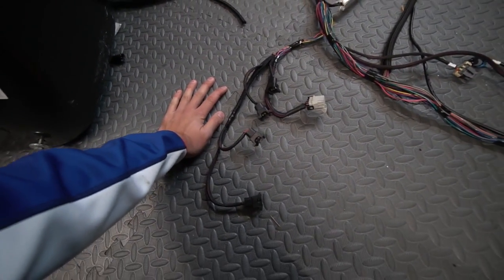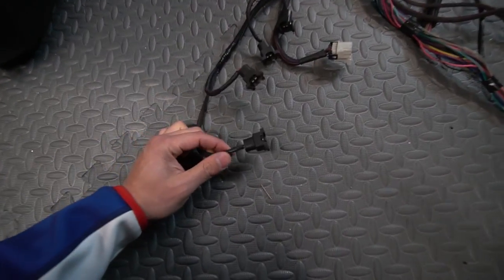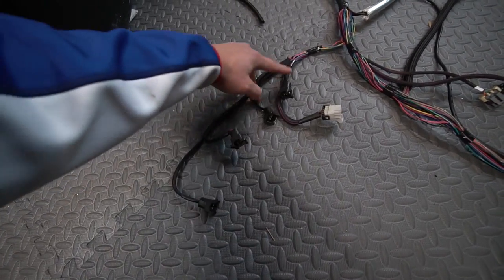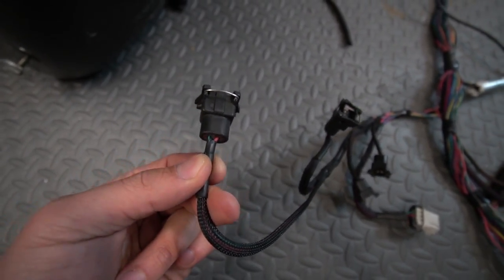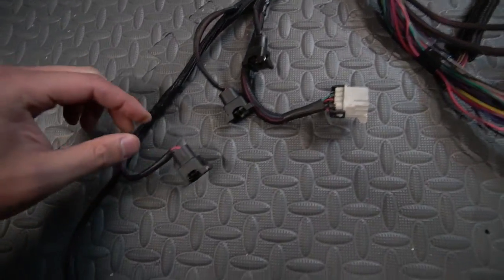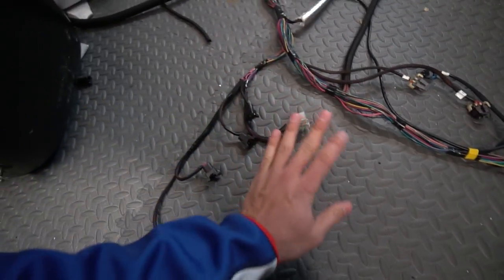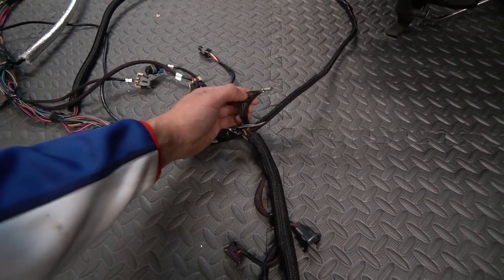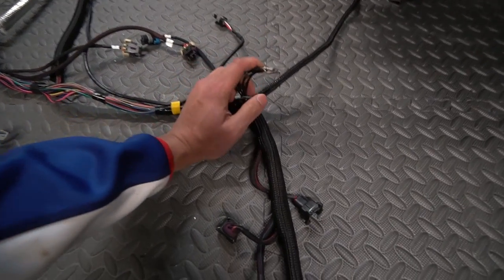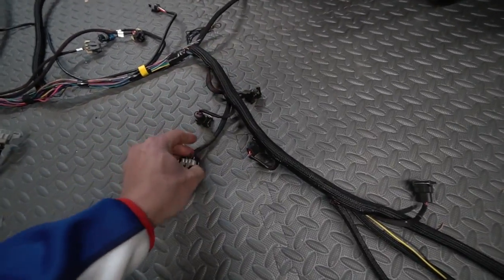Very simple — you got a plug for the coil packs, and then you got four injectors. These injectors are in order — one, two, three, four. If you get this mixed up, no worries, because these are color coded: the fourth one is green, the third one is blue, and then you got grey, yellow, and so forth. Easy to pinpoint. These are also different lengths so it's hard to mix them up in the first place. On the driver's side, first of all you got ground for the whole harness — very important, make sure you hook this up or you're gonna have ground issues and you won't have a fun time. And then the coil packs repeat again.